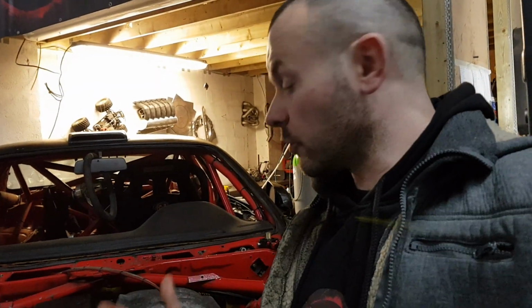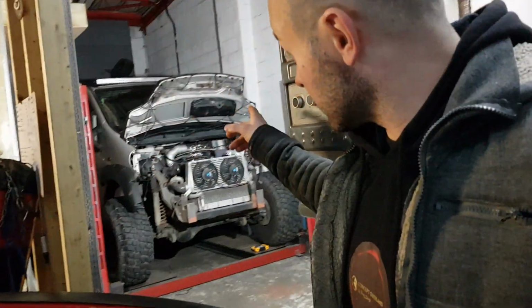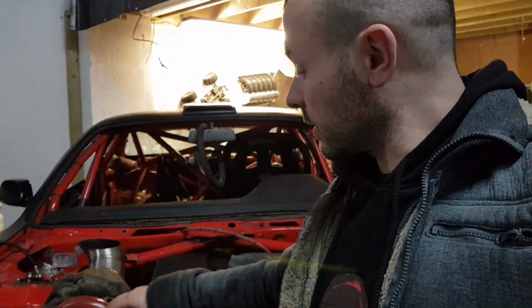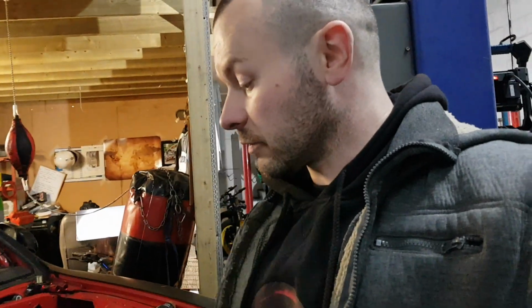Yes, you need them slightly bigger, you have to tweak them a little bit to give you more power. This is another beautiful thing. Now, just because this is completely mechanical, doesn't have the ECU, doesn't mean it doesn't deliver great power. That engine there runs nearly 300 brake horsepower once remapped. This, with a bigger turbo, yes, you have to invest more money. With a nice turbo system and tweaked pump, it can deliver actually over 600 brake horsepower and over 1000 Nm of torque.